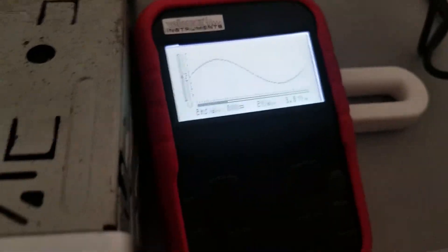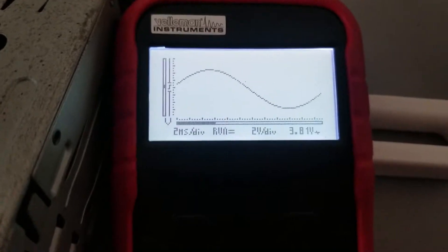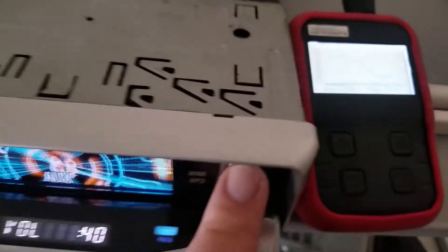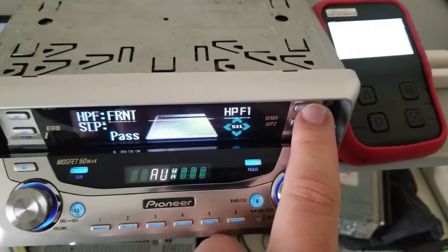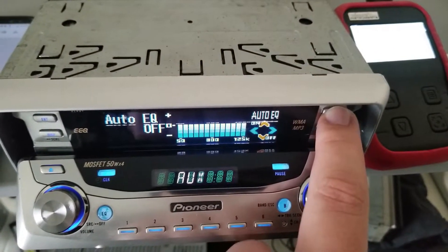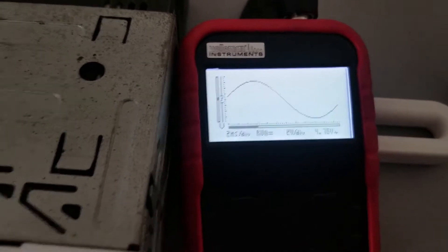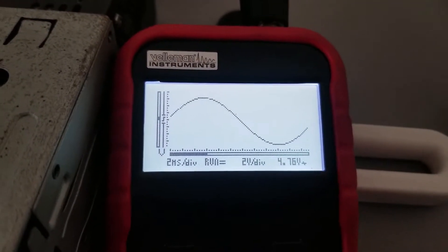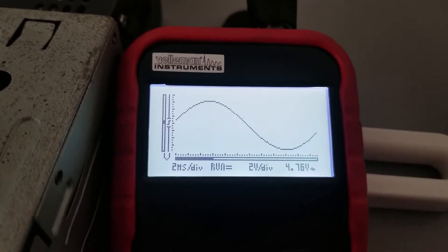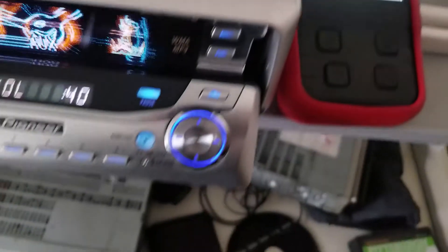That's some pretty good voltage. Since I already tested this and can go to around 4.7 or 4.5 volts, I'll go into the audio menu by holding audio, go to source level adjustment, and click it up one at a time. I went up by one click and I'm at 4.76 volts — super clean. So now my volume's all the way up on my phone and my head unit, and when I play a 40 hertz test tone I'll have 4.76 volts clean.